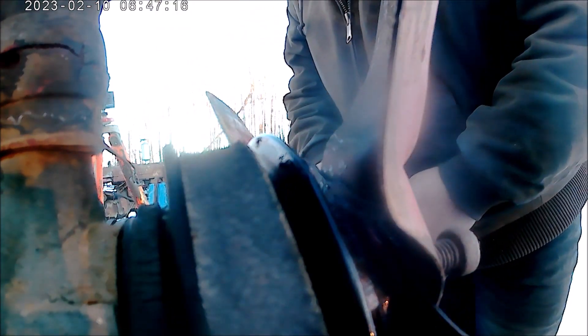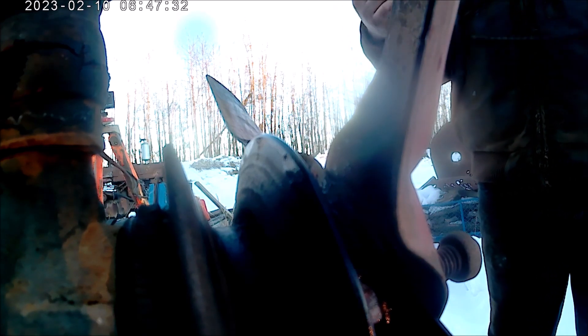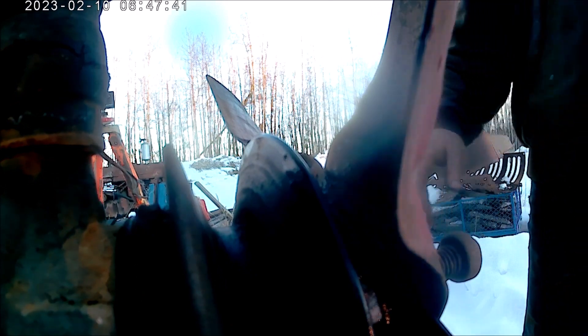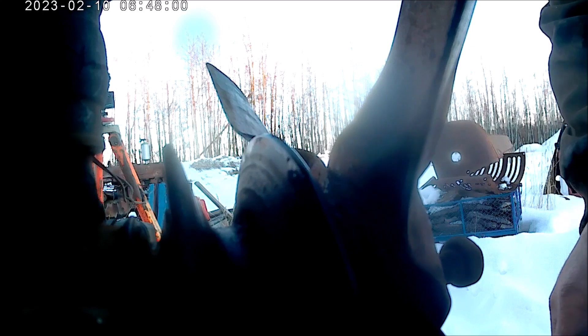There we go — it's off. Well, I gotta give it credit — it's an old belt but it'll still run. The closest substitute you can do is get a C-belt for this, and the C-belt works on them. I've used a C-belt on a W-9 and they work fine. This is better because there's clearance to use a C-belt on the W-400, whereas on a W-9 there's really not — and it's hard to get them on the bottom pulley on a W-9.